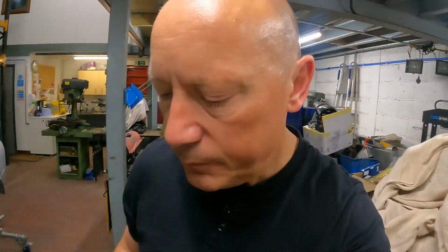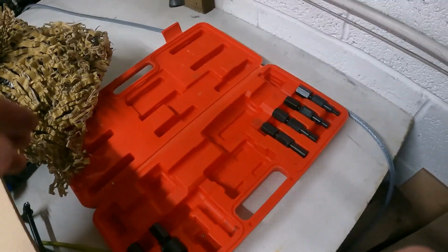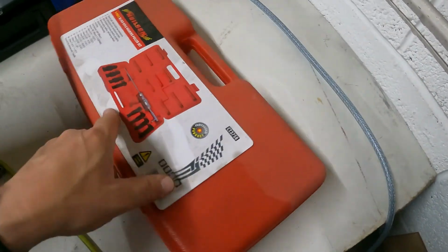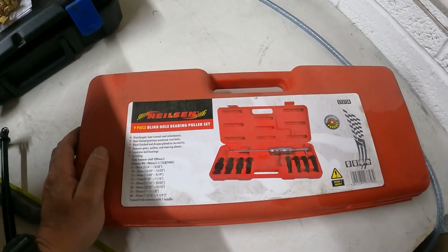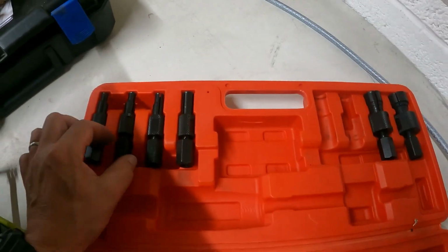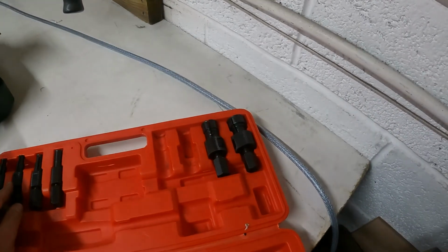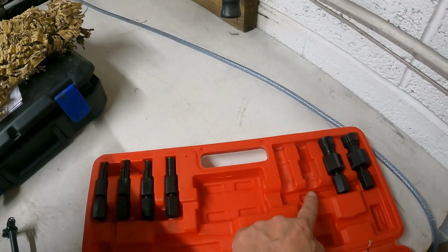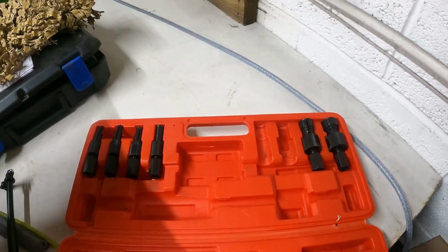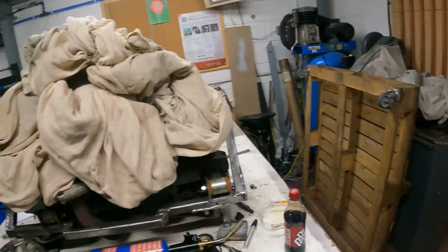I'll take you off the stand again. Follow me. Here it is. It's in this big red box. Half the bits are missing because I've got them out, but that's what it is. 9-piece blind hole bearing puller set. It's got all these different size expanding bits for different size of bearings, and as you can see, I've only ever used 2 of them because they're the closest size to the roller bearings that I'm dealing with. So I'll show you what they are. Yeah, but that was the set. That's what you need to buy, something like that.